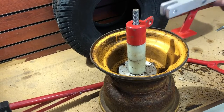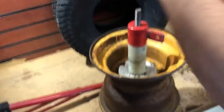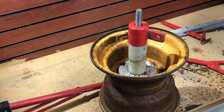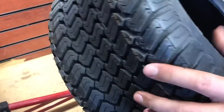Go ahead and do the same thing here where you put the spacer, or that metal piece that's almost V-shaped, if you will. I don't know, let's call it the angular metal piece. Put your nylon spacers on and then torque that top nut down, because this is the same scenario where you're going to need a lot of torque.